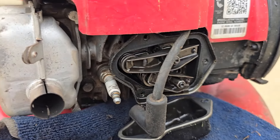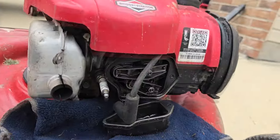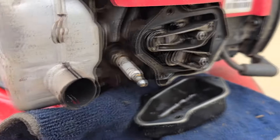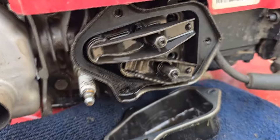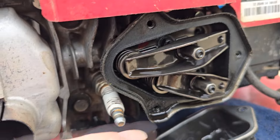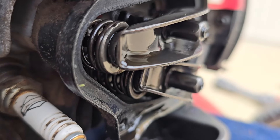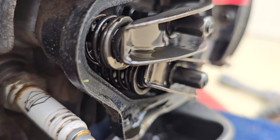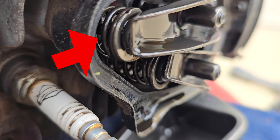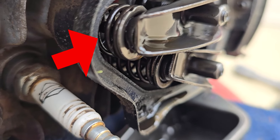Since you're here, I'm going to check the valve lash on these. I'll show you what you should be able to see if things are working properly. I'm going to pull this string — the exhaust valve is on top; that has the compression release on it. Obviously, that's intake. Now watch for just the tiniest amount of movement here. See that? That's the compression release.